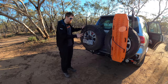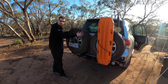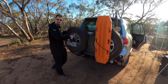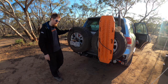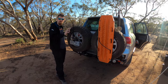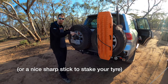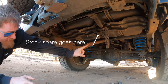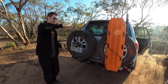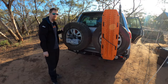Having two spare tires is pretty important for remote area touring for two reasons. First, if you get a flat tire, due to the distances involved you may well end up with a second flat before you've got the first one fixed. Second, sometimes you get two flats because instead of an errant nail or screw on city roads, it's a sharp rock and you run over it with two wheels. The stock spare tire location is under the back, but we've shifted them up to the rear bar because going up a steep hill that spare tire will restrict your departure angle and you don't want to drag it along the ground.